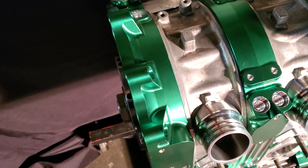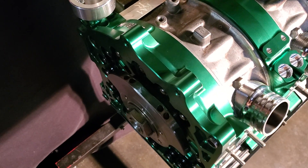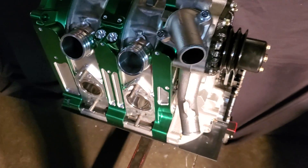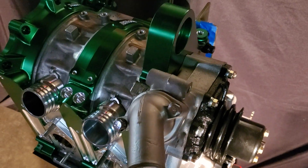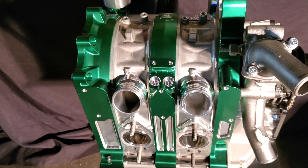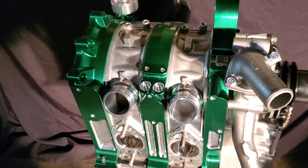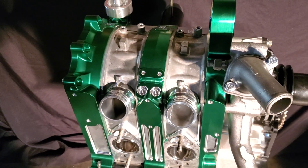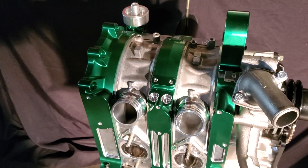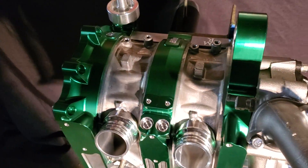I did the side cutting personally, and Chip Ursu did the lightening — high speed balanced side cut rotors. A lot of tried and true internal work that created the blueprinting for the specs that we're running in this setup. We had a horsepower goal of the 400 to 500 horsepower range with reliability in mind. So therefore the balancing, narrowing of those series six rotors, and lightening all correspond with our horsepower and longevity goals.